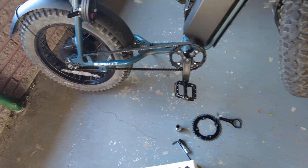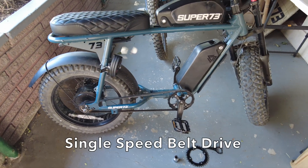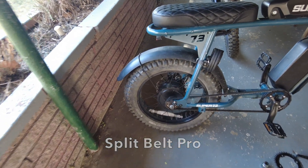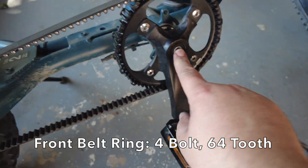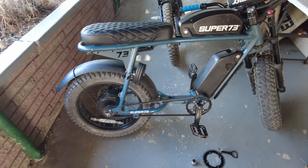I wish I could have shown you the step-by-step footage but I did my best to explain it. I'm not a bike expert — I was able to do this myself as a DIY, but if any of it makes you uncomfortable take it to a bike shop. I'm very happy with how it turned out. I'm going to put up on screen the specs of exactly what I ordered so you'll know what to get. One thing they ask before you order the belt is to measure from the center of one axle bolt to the center of the other and convert inches to millimeters. This video was not sponsored — I paid for the kit myself and I'm just really excited about it.